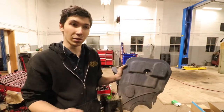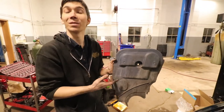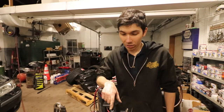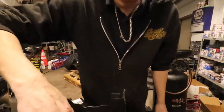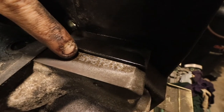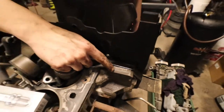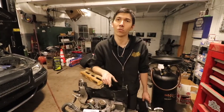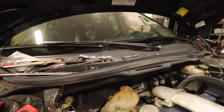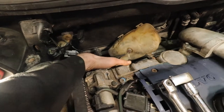About engine serial numbers — some older and newer ones are different. Your serial number sticker would be here but mine is missing after 260,000 miles. There are two ways to find it: call the dealer with your VIN — they can look it up — but that only works if you're sure the engine is original to the car. Otherwise, on the back of the block near cylinder one, there is a serial number, and right above it — for an R it'll say B5254T, for a T5 it'll say B5244T, and so on.